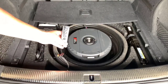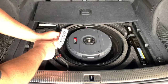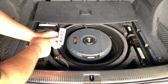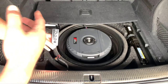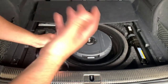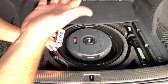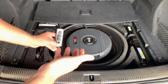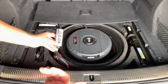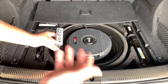I will go over the controls in depth as to what's what here. In general, the main controls are the gain, the bass boost, the low-pass frequency, and the phase. If you're playing it and it doesn't seem like it's hitting strong or you're getting enough vibration, sometimes hitting the phase button will reverse the phase of the woofer, which will put it in sync with the rest of the vehicle. Sometimes you have to do that in forward and rear facing scenarios to get the phase correct so the bass notes reflect correctly.